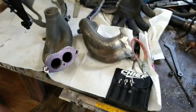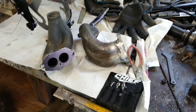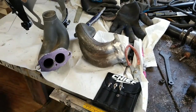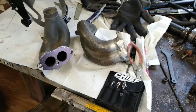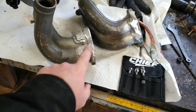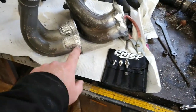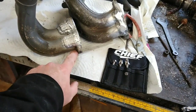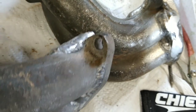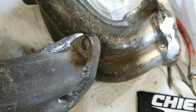We're here to port some intake manifolds. We had to weld them up a little bit for the flange — we didn't go crazy up here because you can't get up there with the size cutters I've got, these things are only about two inches long. On this side here too, I want to give you guys a word of caution: see how much space is there? Yes, you can fill this all up with weld, but then you'll never get a nut on it.